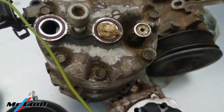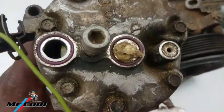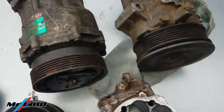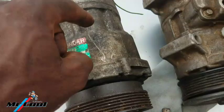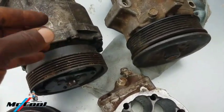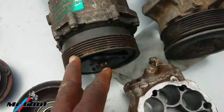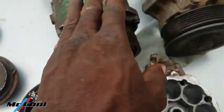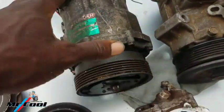Some of those structural failures can be an easy fix. If there's just a little bit of rattling noise, add oil in increments — say five milliliters at a time. Add the first five mil, listen; add the second five mil, listen again. If the noise is due to lack of oil, it will reduce with each addition. But if you add up to 15 milliliters and the noise doesn't go away, then it is a very serious structural failure and you'll need to replace the entire compressor assembly.